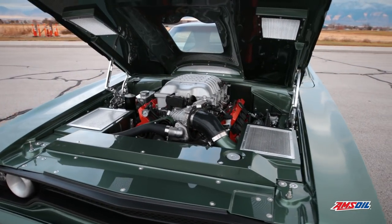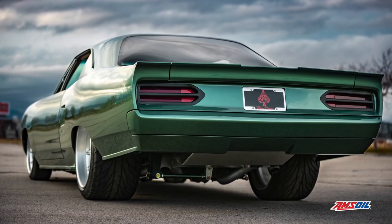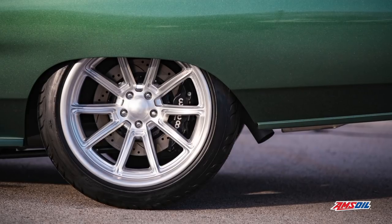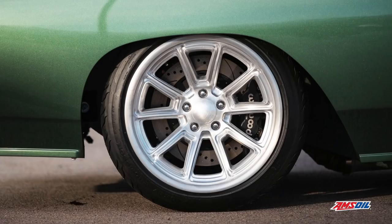This little motor made right at 900 horsepower, backed by a six-speed transmission, sitting on Scott's Hot Rods IFS, narrowed nine-inch forward in the rear with triangulated four-link with a crazy watts-link panhard bar. Big Wilwood disc brakes like our typical fashion, and then custom three-piece EVOD wheels — 20 by 15s in the rear, 18 by 8s up front.